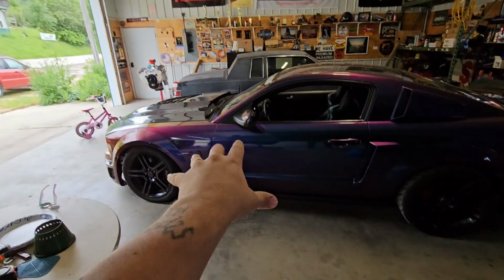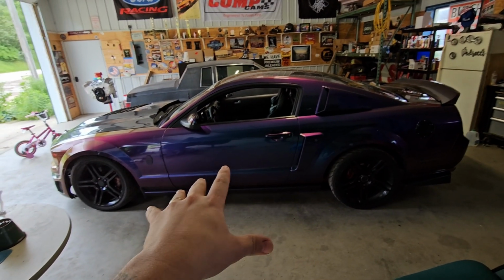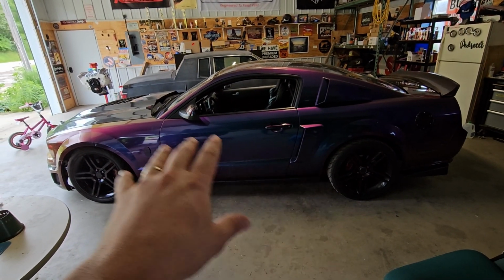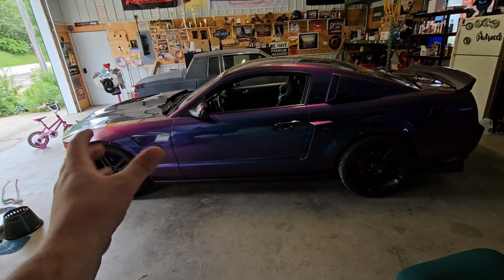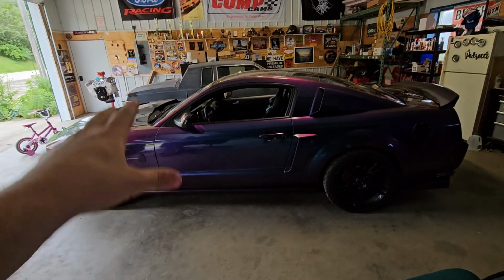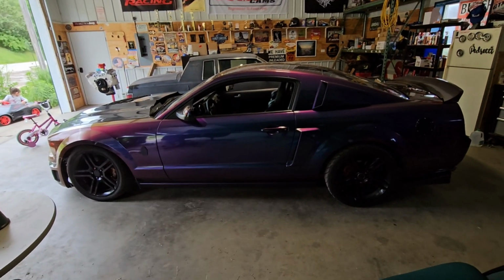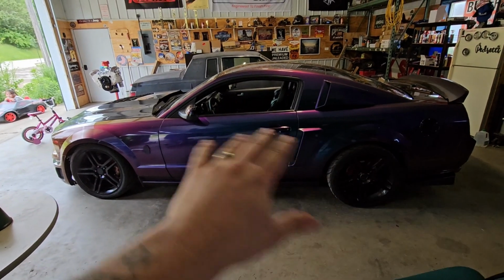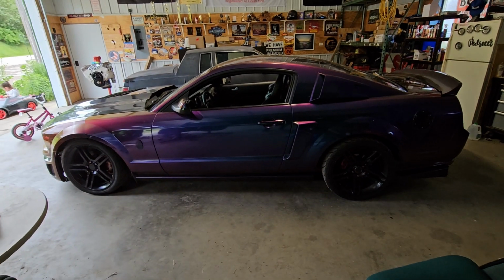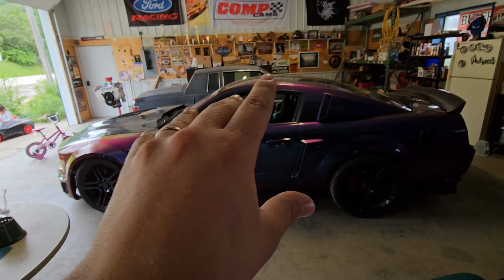All right. The biggest thing about this car, compared to cars I've had in the past, is the reliability. This is a 2008 model. I know the 05s, 06, and mid 07s had the spark plug issues. In 07, they changed that spark plug so you don't break spark plugs anymore. There's a few other things they changed up to make it better. This is a 2008 model, spark plug issue, don't have it. This whole car has been very reliable. I've never had any real problems besides regular maintenance. Still same transmission, same motor, the whole nine yards. It's been a great, great car.